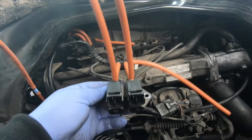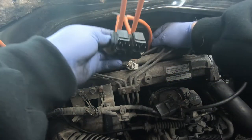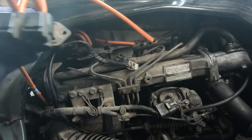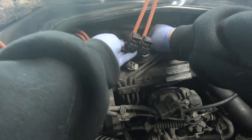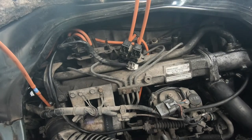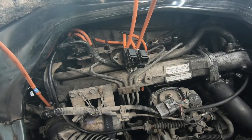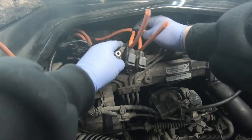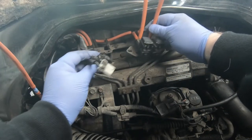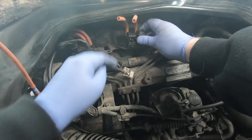Now we're on the right side with the solenoids, and this little one has to go down to that little tube, so you really want to go just straight down there. Hopefully you can see it at the bottom. The fun bit will be getting that on, but while we're here let's connect up our four-way vacuum pipe — pop that out of that — yes, we've still got our connectors. These go a specific way — you need to bend that down like that, out of your way.